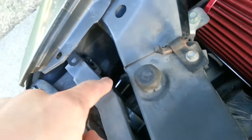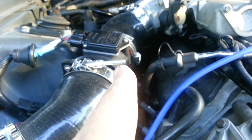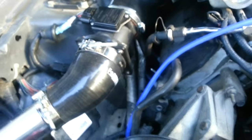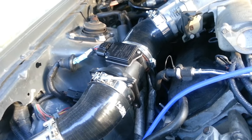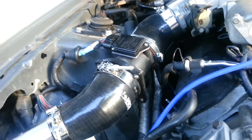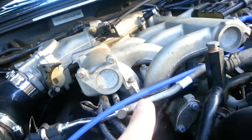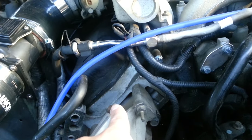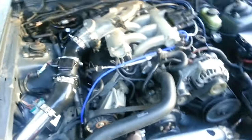On my car the piping travels through the fender and up. I have my mass airflow sensor placed after the turbo because my intake temperature sensor is part of my MAF sensor, and for good readings it needs to be after the turbo — though I might add a separate intake temperature sensor in the future. All that compressed air from the turbo goes into the motor. More air means more fuel can go in, which means more power output — that's why you use a turbo.